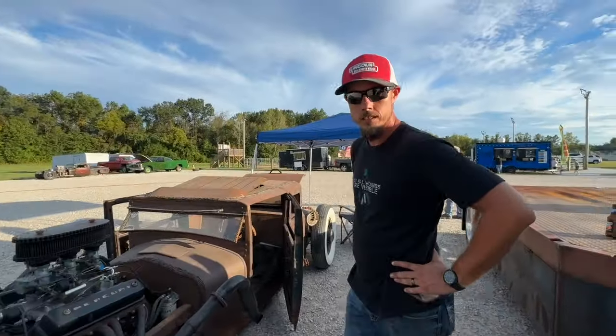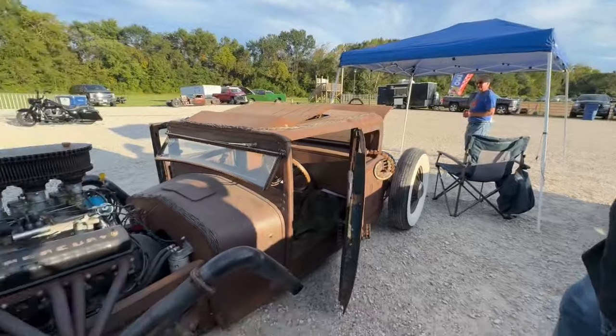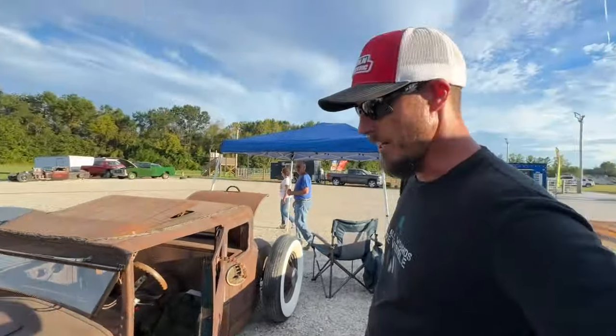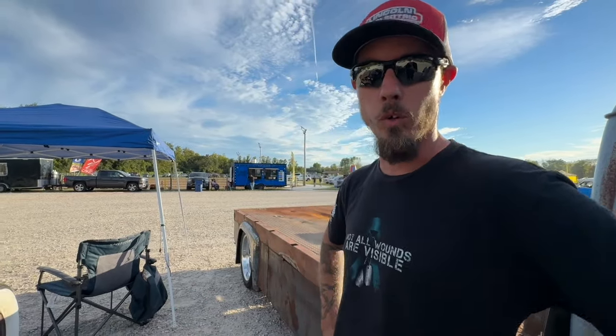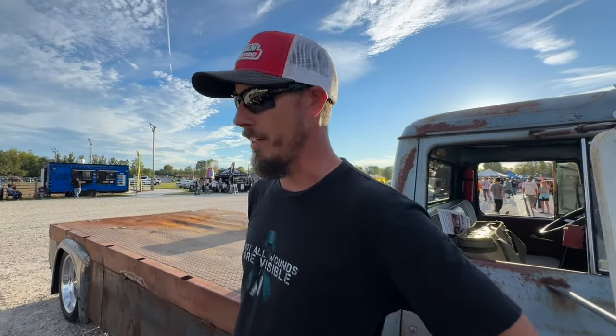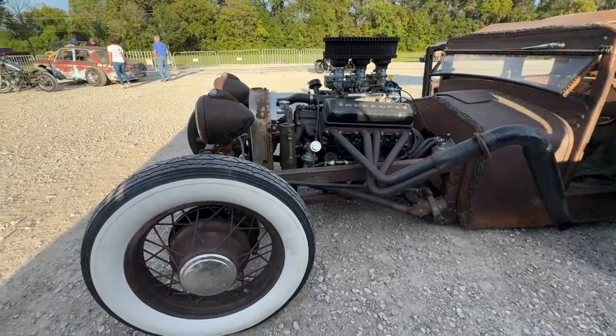Mate, whereabouts are you from? Ewing, Missouri. What's your name, buddy? Josh Endicott. Good to meet you, Josh. You too. Tell me about this sweet looking hot rod. So the front half is a 1928 model. No, not Model A. The front half is a 1928 Essex. It started life as a four-door sedan. And it was missing a front door, so I grafted two rear doors together and added Model A sport coupe rear quarters that I found in a farmer's field. And wrapped it all together.